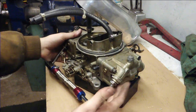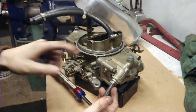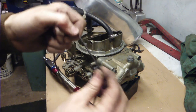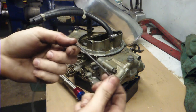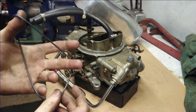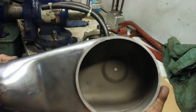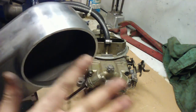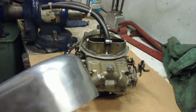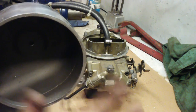The next thing I did was I couldn't get the stock carburetor filter gasket to seal on the carburetor hat. So I went online and found these gaskets - they're like rubber, stretch a little bit, and they're made for carburetor hats for turbo application so they seal really well. A little expensive - you have to buy packs of three and they're about $100 for a pack. But definitely worth it. I also had some sealing issues at first because the face around the carb hat was not flat. I got a flat surface, grabbed some sandpaper, sanded it down just a little bit, and it seals great now. If you're having sealing issues around that face, sand it down, make sure it's flat and even.